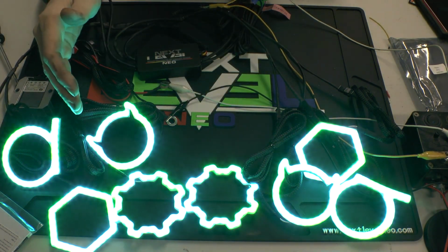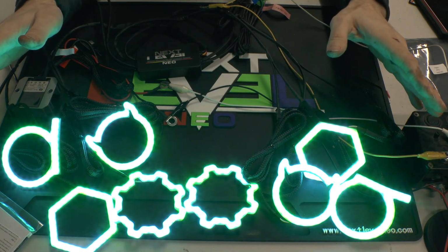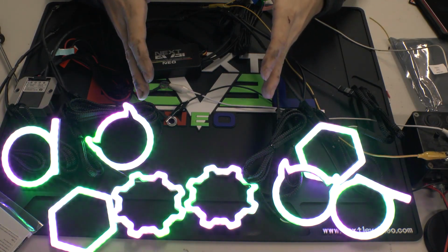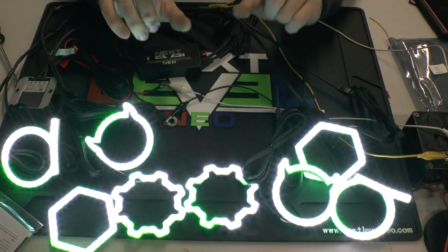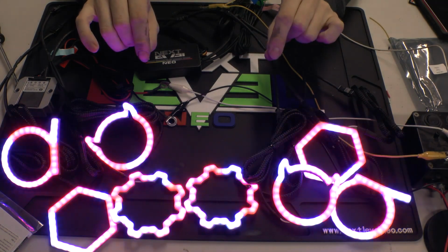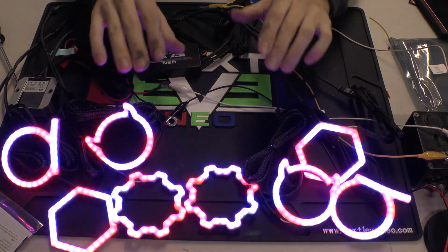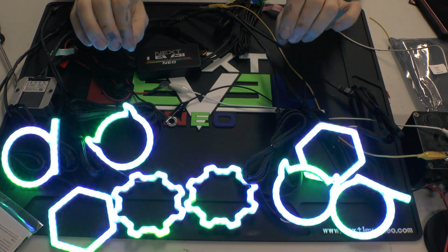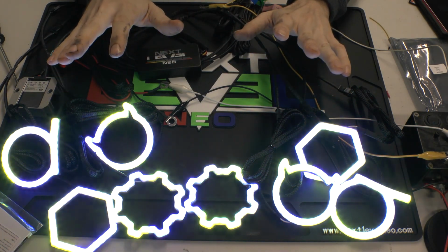You can put it on there, and it's got two wires going in, which would be the right side and left side, and then it can actually put three wires out, which would be your right side, left side turn, and then one single brake. That would work as far as taillights go. Headlights, they don't do that, so you won't have to worry about any of that stuff. Keep in mind, hyperflash resistors would be needed if you are eliminating a turn signal bulb, like if it's a halogen bulb, and you're eliminating that to put these in, you will need it. In the event that you are maintaining all halogen turn signal bulbs in your car, you will not have to worry about hyperflash resistors. So just a couple little things to keep in mind.